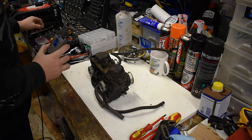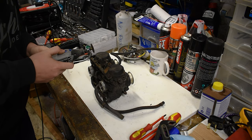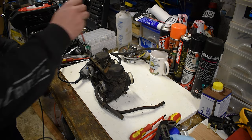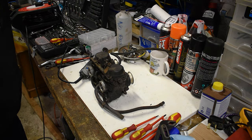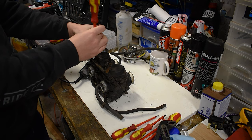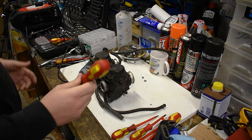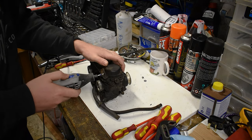Don't forget your safety glasses. The plan is to cut a notch and then see if I can turn it out. Be careful not to cut too deep otherwise you might not have enough screw left to actually turn. I need to find my bigger screwdriver - right here. There we go, that worked - ingenuity and all that. So obviously this is your choke bar, and it's pretty clear we're going to need a new one of them anyway, but look, it's working and that's what matters.